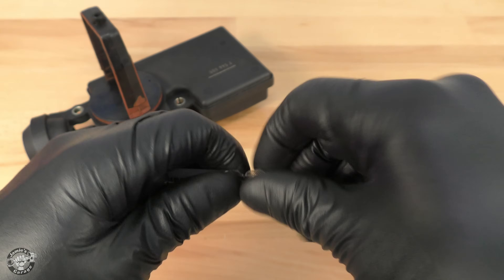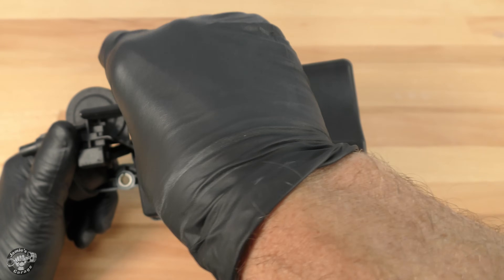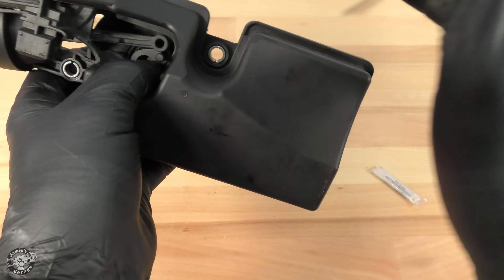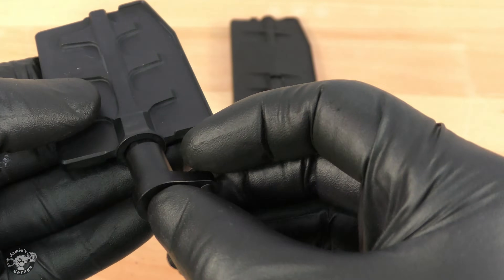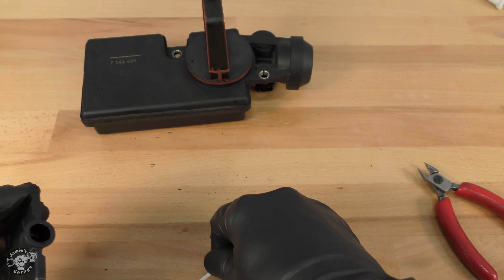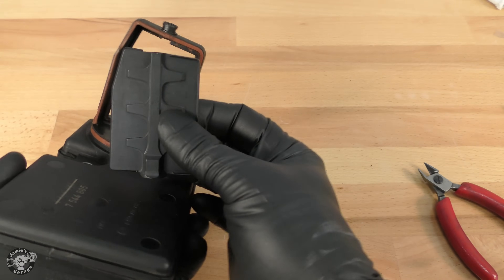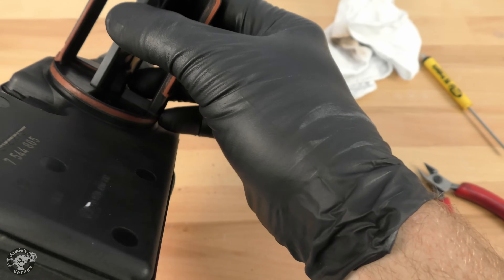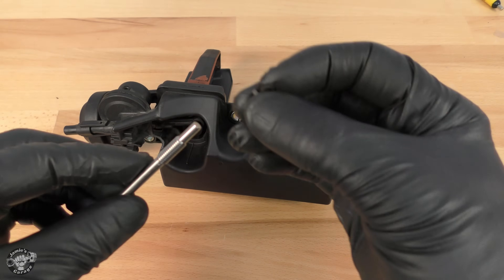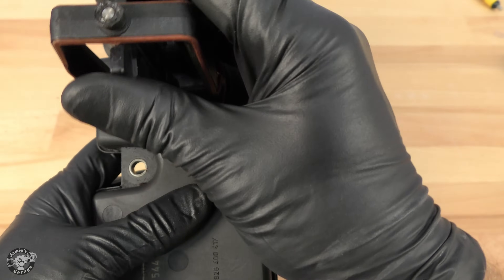Now that it's all clean, it's time to lube our crank. We only want to lube the base of the bell crank, not the tip — you'll see why in just a moment. I slide the bell crank into the DISA valve and install the actuator rod. I then clean the tip of the bell crank to make sure it's free of any grease. The tip of the bell crank is inserted into the flap, and even though it's a tight machine tolerance, we use red threadlocker in the female side of the flapper valve to make up any lost clearances. You don't want to use too much here because you don't want overflow into the bearing. While installing the flapper valve, pay attention to the notch in the valve in relation to the frame. Now we install the flap and with the opposite hand slide the bell crank into the flap. The screw is installed next — first a lock washer and then a little threadlocker. After installing the screw, I check for proper operation of the valve and for any excessive play.